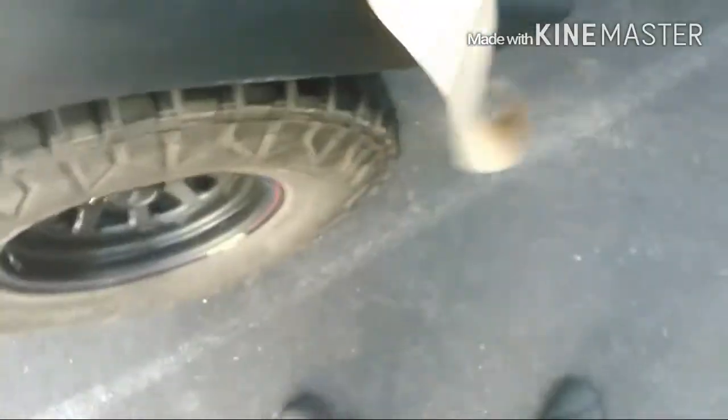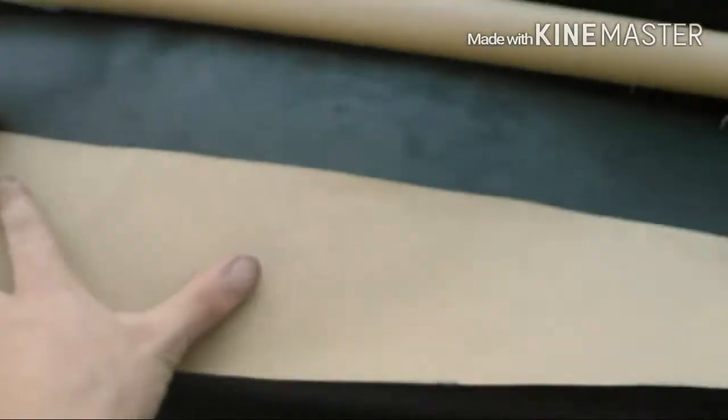And then you're going to take it and flip it over and lay it on this flare and trace it out. And that's where you're going to make your cut. Now this obviously isn't perfect. This is just getting it in the ballpark. So you get the idea. I'll come back after I trace that.